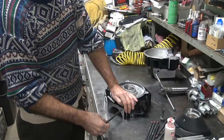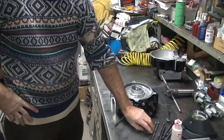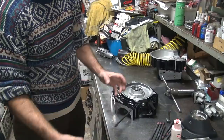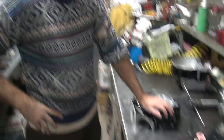I don't like this - it creeps me right out. I'm wondering if you can use a thread locker in it - that is thread locker right there, it's doing a good job. I could put some sleeve retainer on there - it would lock that sucker up. That might be a good option if you wanted to wait 24 hours, but you have to put the cylinder on and torque it down so they'd all pull straight. That just creeps me out. What other options do we have? Use real parts - non-Screaming Eagle parts. Do we have something that has a shoulder? Let's take a look in stock and see what we've got.